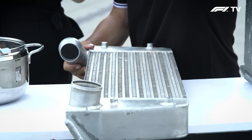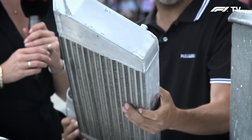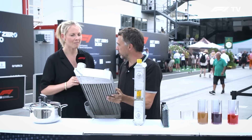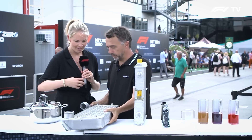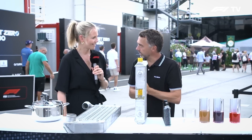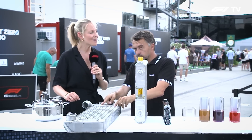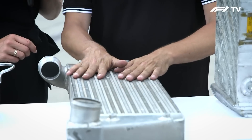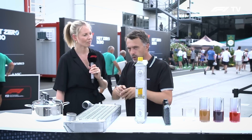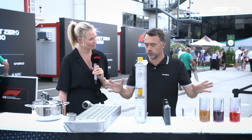How? We put the hot air into the vent, we put it on the side of the car — again like the water radiator — and the airflow coming from front to back cools down the air before we put it into the engine, then it goes into the intake and the combustion engine. Some teams use water to cool down the air — it's a very small piece that goes inside the chassis, like Mercedes or Ferrari — different configuration, but the target is always the same: cool down the liquids to keep everything under control.